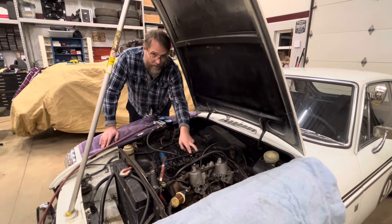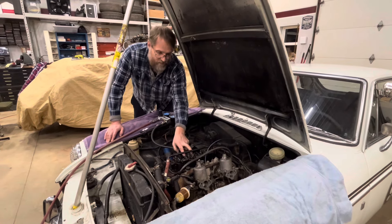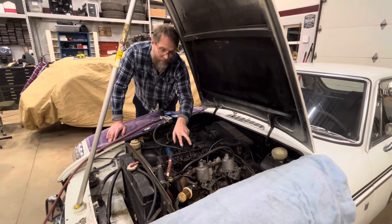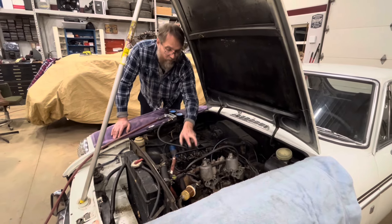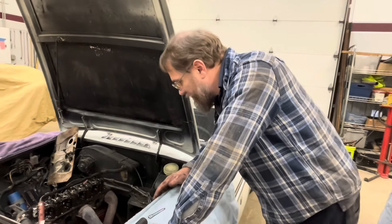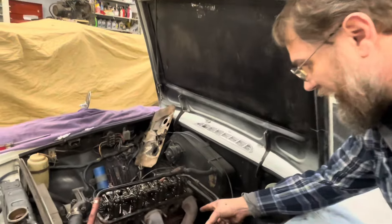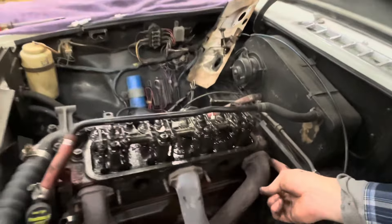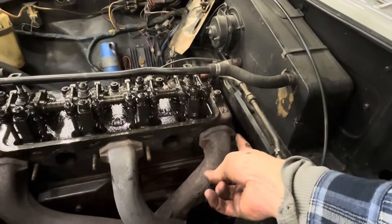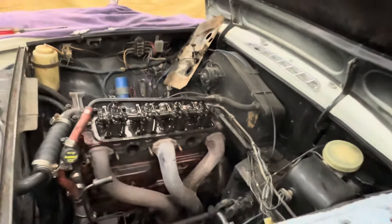We also have a fair amount of air coming out the exhaust, so both valves are leaking. We'll bring the other cylinder up to top dead center and check the same thing, then pull the cylinder off. He had mentioned the exhaust manifold was leaking, and there was no stud or bolt in the last hole back here — so yeah, that could create a nice little exhaust leak.